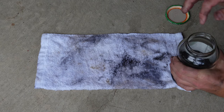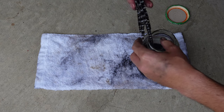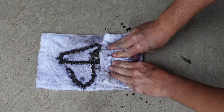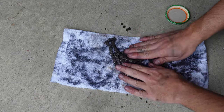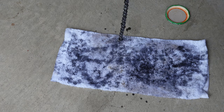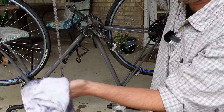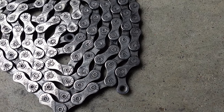It's time to take the chain out. I have this old rag that I'm going to use to get any of the grease or whatever may come out. So just slowly pull it out — try not to make a mess and splash. Try not to splash any extra greasy lighter fluid anywhere. I did a little bit, but that should clean up no problem. Now that I have the bulk of it off, just kind of shake it and now I can handle it more easily without splashing and making a mess. After cleaning it with the lighter fluid and wiping it down with my rag, it looks nice and clean now.